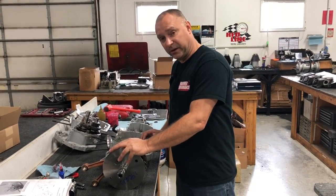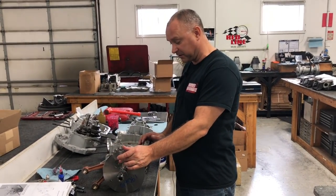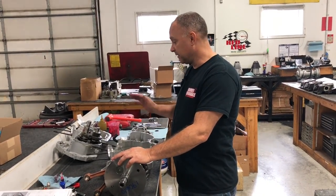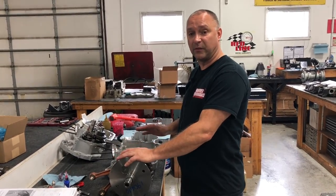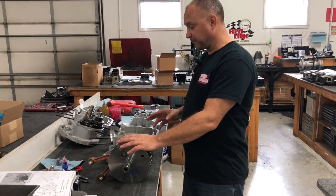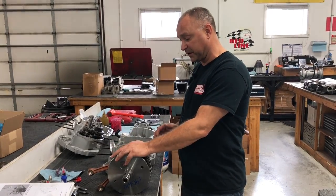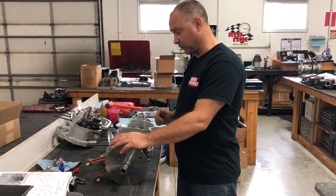You get a far superior crank. Lighter, stronger rods, 1.5 inch crank pin instead of a 1.25. So it's a much, much better assembly than the stock replacement. So we highly recommend, if you can do this and you have a bad crank and you're doing this, that you do upgrade to this better crank. That's what we've done, just because of cost and a better, far superior flywheel assembly as we put it back together and continue to tune packages and whatnot.